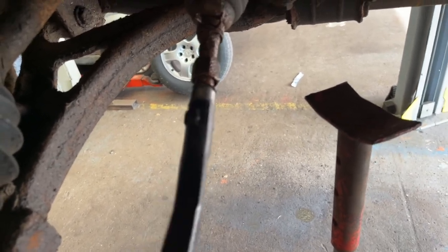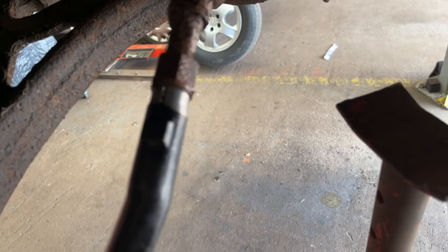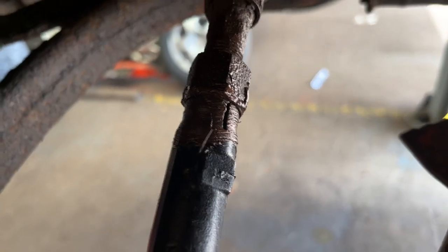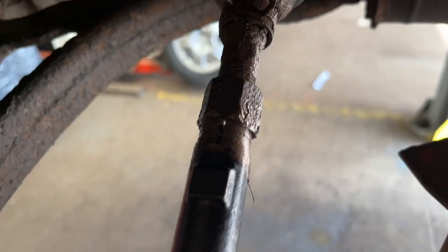Take it up to the top of the tie rod like so. These go over and in — they're tapered. I'm going to put a bit of copper grease on that, just smear it around, because that's normally where it seizes — where the face touches the raw metal. So when it goes over the face and into the taper, the copper grease acts as a barrier, stopping it seizing together.